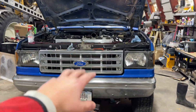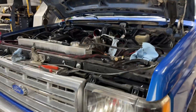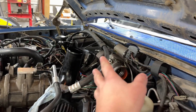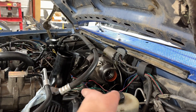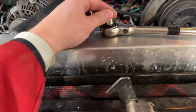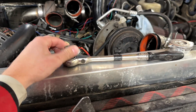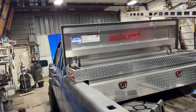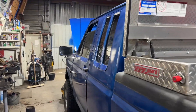Maybe kind of a boring video, but I hope it's somewhat informative. I had no real difficulties, and especially if you're naturally aspirated this is going to be pretty easy. The turbo did get in the way a couple times, and the steel fuel lines end up in the way more, but you can get around them with a universal joint and a quarter-inch. For about three quarters of them I just used a 3/8 Snap-on ratchet and a long 3/8 socket. Anyway, thanks for watching — we'll see you guys next time. I will shortly be coming out with a video on the 6.0 also, so keep tuned for that.